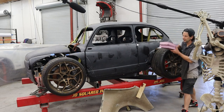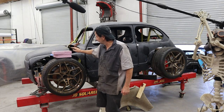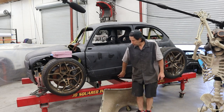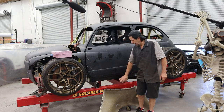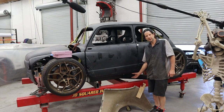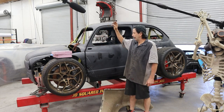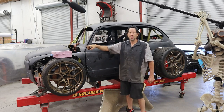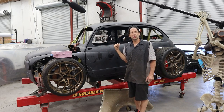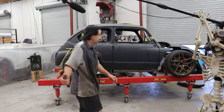We need four inches of clearance here and also four inches of clearance here. You can see that's already above the actual hood, so that might have a hump — I'm not exactly sure how I want to do that, or I can raise this car up just a little bit. You're not going to notice this actual sill down here, and if I do what I'm talking about with the opening in the back, that's going to come out anyway. I have to address this before I actually design the hoops, because if this is going to go up, the hoops need to be longer. So I'll flip the car around to show you what it looks like and give you an idea of where I'm going with this.